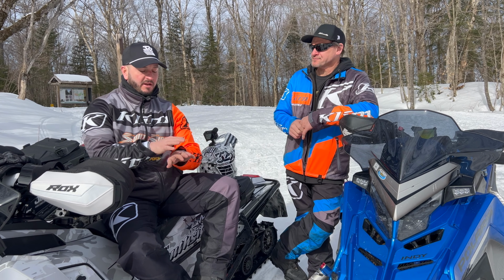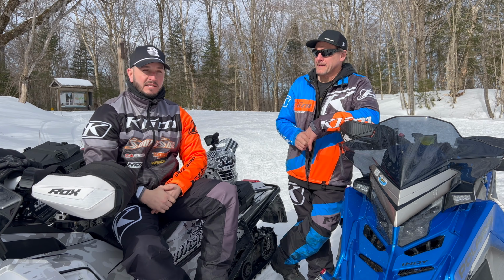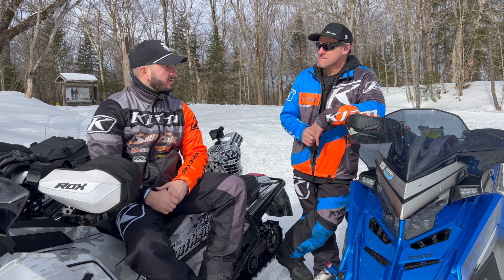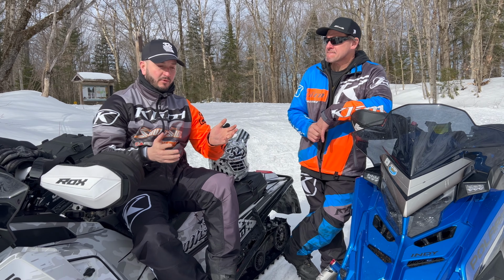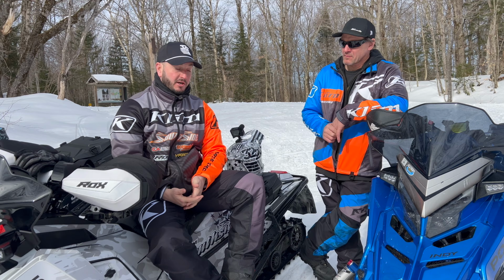When we talk about rebound, guys, it's when you go through the travel and it bounces back and almost wants to hit you in the butt, or you feel it kick up all the way up. That's what you say when the rebound's too fast. These things are known for it, and even after valving them, they were still way too fast. We didn't go far enough to find that happy medium. So we went back to the drawing board, and that's where we are today.